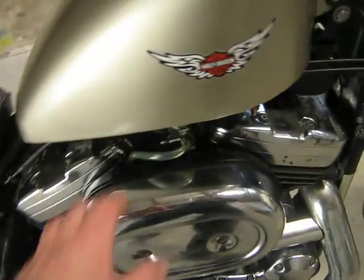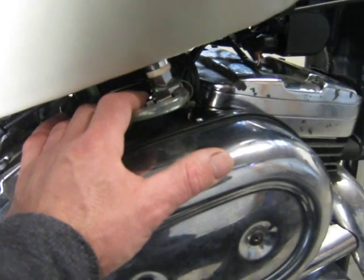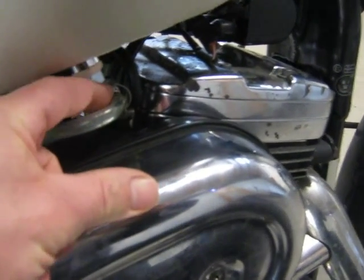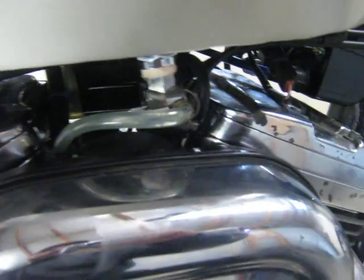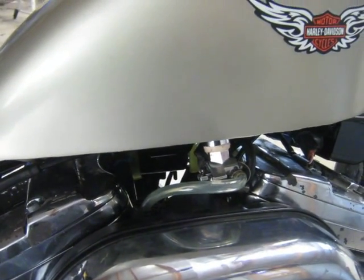So I took the fuel tap off and I found that in the on and reserve position I can get air and fluid through. That means that it'll flow straight through from the tank and out of the petcock. So there's a big open hole where the thread is, and fuel will flow through the fuel tap. However, when I connect it up to the carburetor, then no fuel flow with the petcock on the on position.